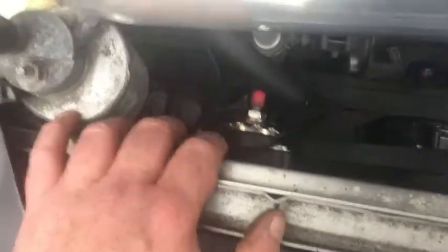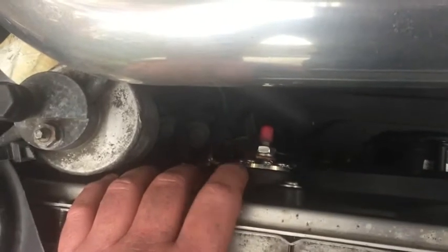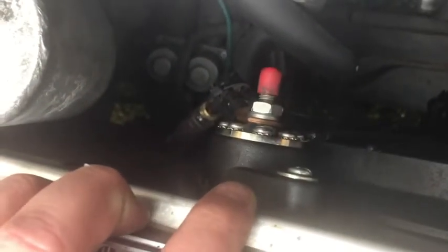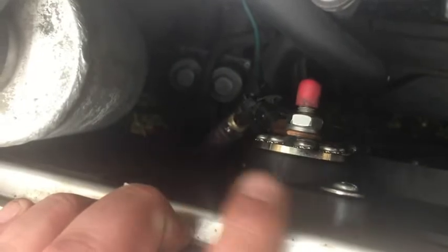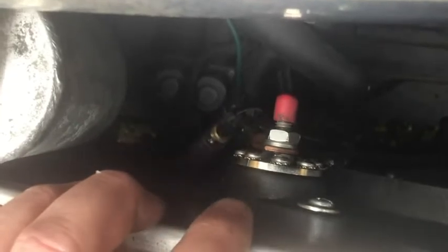After I finally got the wiring issue sorted, it's worked fine for two years. What happened was I was using eight-gauge wiring, and after a while it would draw too much amperage, heat up, and make the fuse link blow. The distribution block is the real deal. Going from a six-gauge wire with a crimp connection could set up corrosion or heat over time — I just tend to think this distribution block is a better way of doing it, and I've never had a problem since.